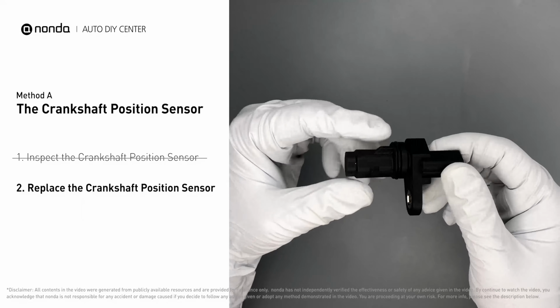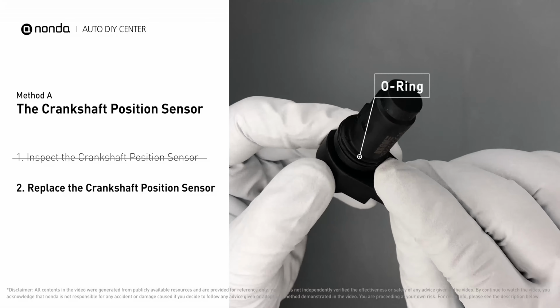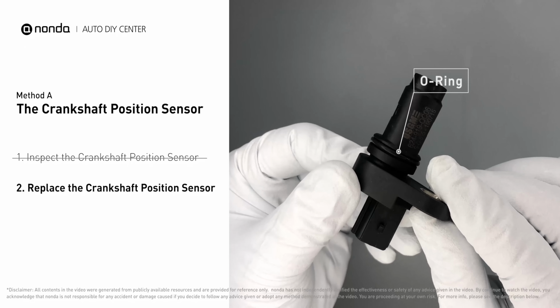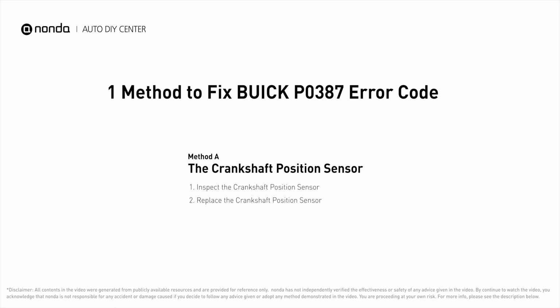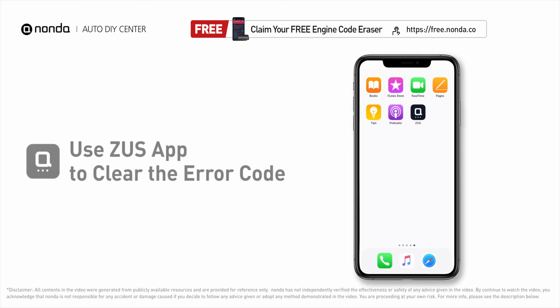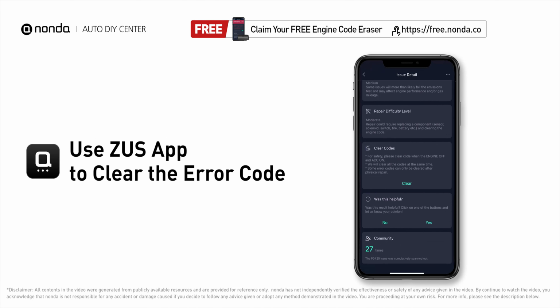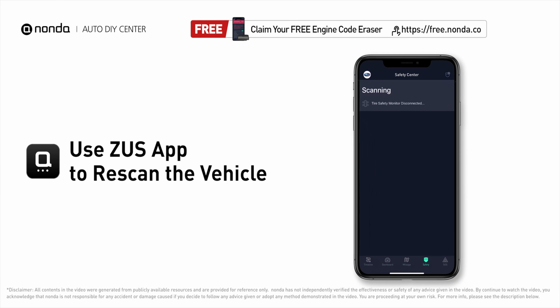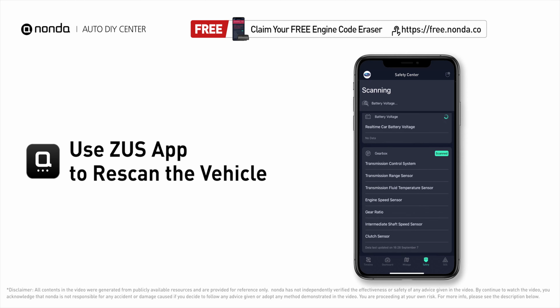Check to make sure the O-ring from the sensor hasn't fallen into its hole. Then replace it with a new crankshaft position sensor. So here is one of the most practical solutions to fix Buick's P0387 error code. After the repair, you can now use the Zeus app to clear the error code, and tap the rescan button one more time to make sure everything is fine with your vehicle.